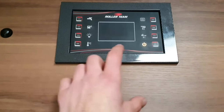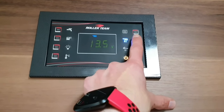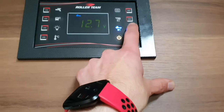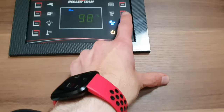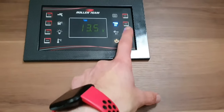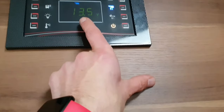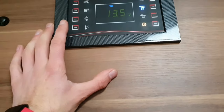The power is on and this shows the voltage of the living area — the two batteries are now at 100%, it says. That's the vehicle battery — a third battery we don't touch. It's up at 13.5 volts; it usually goes up to 14.4 volts, which is the magic number. We should be able to check the lights and stuff — I still had the lights on from last night, so I'll just turn those off.